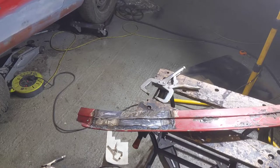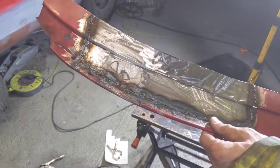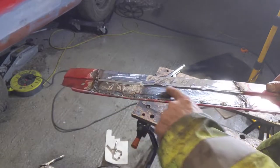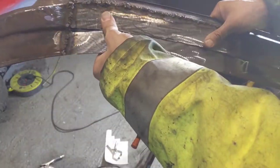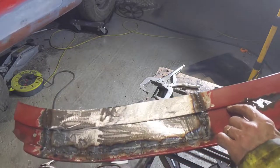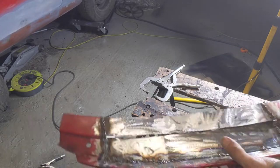What I've done today is cut two separate pieces out — one and two — and welded those in. Obviously it needs cleaning up a lot, there are still some pinholes. The next thing I've got to do is work out how I weld a strip along here to keep them the right distance apart. I've got a bit of an overlap so I want to cut along it so they're more or less at the same level and then stick a piece of metal through.